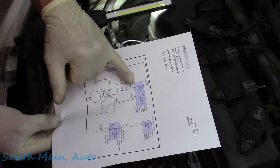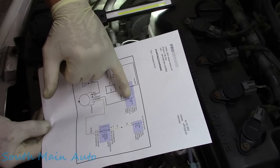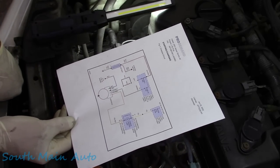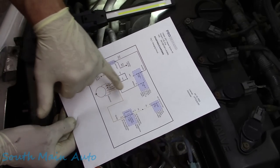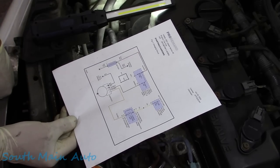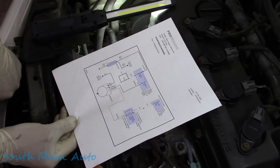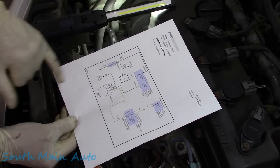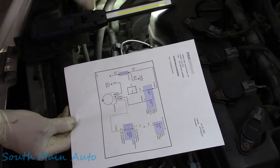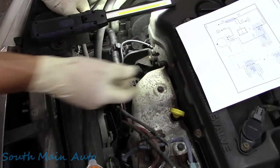And then it appears there must be a fusible link there. And then we have a green with black wire that runs to it. Must be the Gen Sense wire, because it goes to the S terminal. And that just runs off a fuse that appears to be full-time powered. And then we have the one that runs through the charging lamp circuit, which we don't even have to touch, that one on the L circuit, because we know it works because the charging lamp's on. But we can, quick like a bunny, do that. Let me turn the key on, folks.